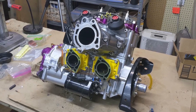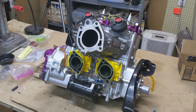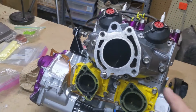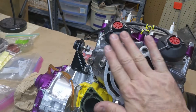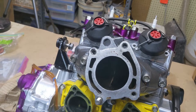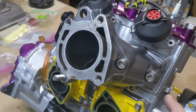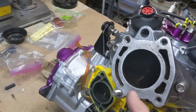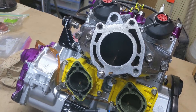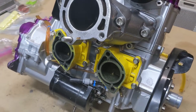If you put the engine together the right way and you squared up all your parts, it shouldn't really have anything as a problem on the inside. Basically, you want to make sure your flanges here are good and square and decked. Sometimes people take those to the machine shop and they deck them, which means they make them perfectly flat — not just here, but also your manifold and all your mating surfaces. I checked all mine; I didn't need to do that, but check yours to see if you do.